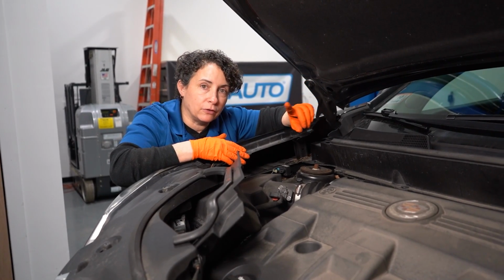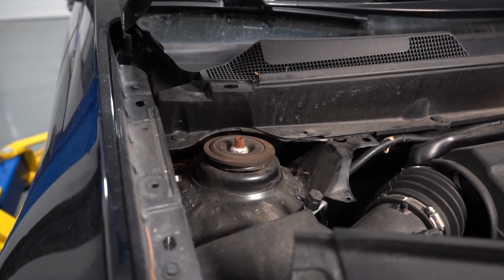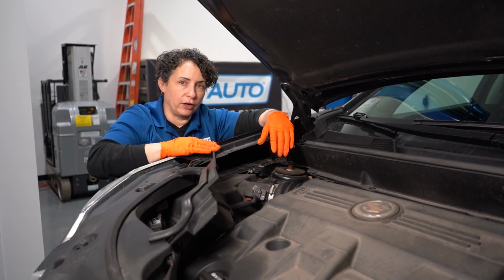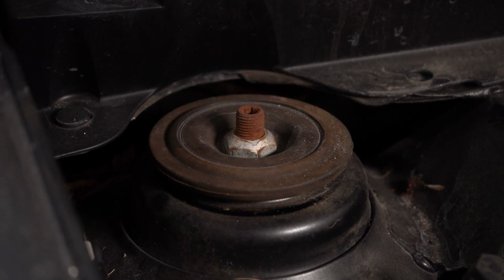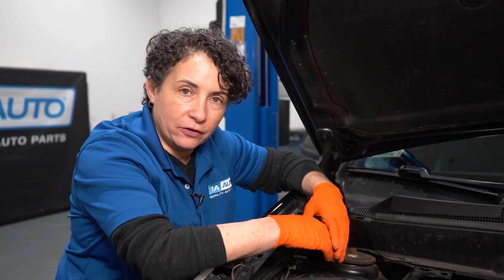I raised the vehicle, so you would do it with a floor jack. You'd raise the lower control arm up, bring the strut so like it's on the road, and then lower the jack completely. So however you need to do it, whether you have it all the way up and then jack it up, then let the jack down. We're looking right here for any motion where the strut cap moves up and down. It should not. So when I said I'm going to lower the car, we want to keep an eye on these strut mounts and to see if they move.